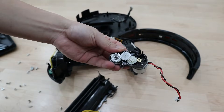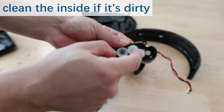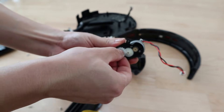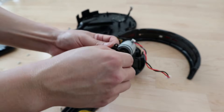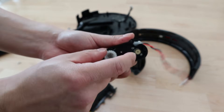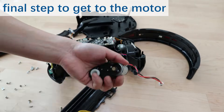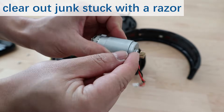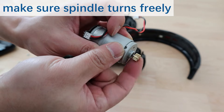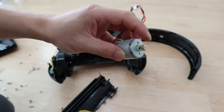This is what the inside looks like. Mine looks fairly clean because I've cleaned it before, but if you have stuff stuck in here feel free to remove it. We need to remove these two screws to get to the motor. What you can do is take a razor and keep turning it to clean the stuff out. This should spin freely — and mine does. If it doesn't spin freely, what you can do is put some machine oil into here.